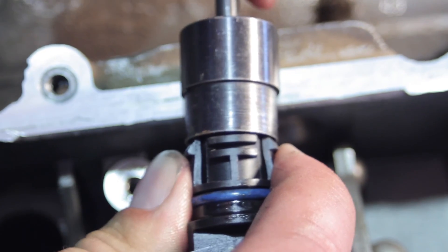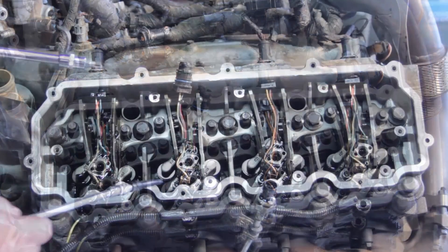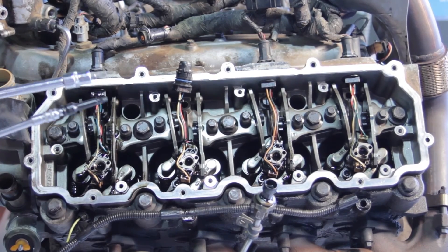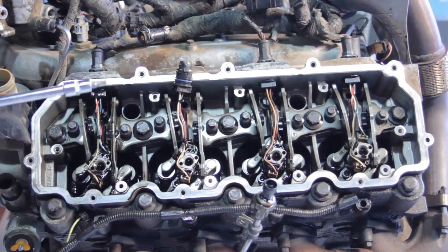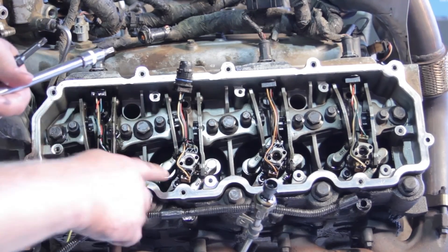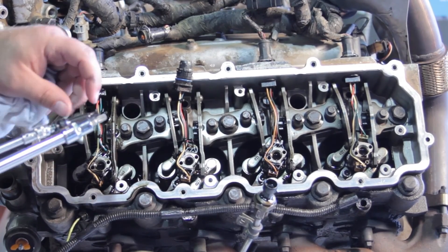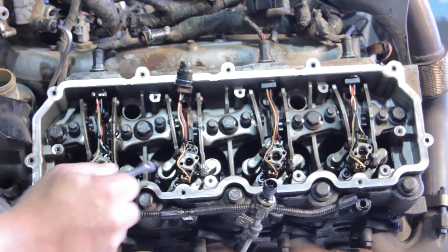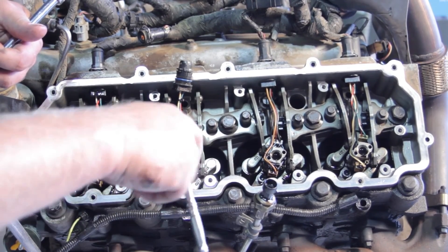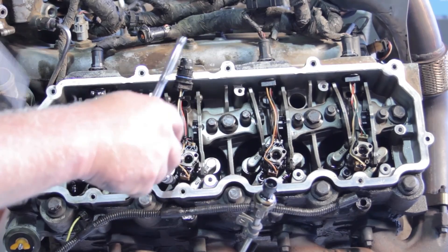You can see how it just slides over the tabs there and gently presses those tabs in to release it. Now let's go ahead and remove the hold-down bolt. We're going to use an extended shank T40 socket here. The temptation for most technicians is to grab their typical T40 and use that, but you'll notice it's hard to get straight on the bolt and what happens is it'll crack off the solenoid on the injector. So we're going to use our extended version here, which is much slimmer and lets us get a straight shot on it. We certainly won't damage the old injector as we take it off, and of course we don't want to damage our new injector when we put it back together. Use an extended shank T40 Torx bit to get the hold-down bolt out of here.